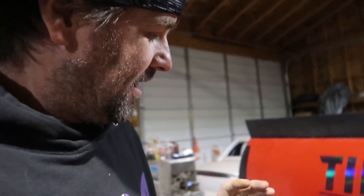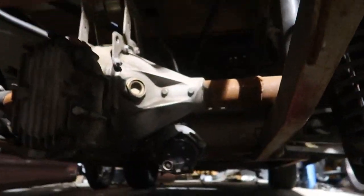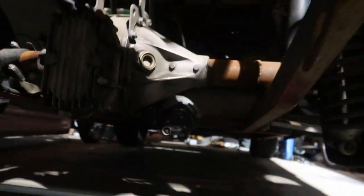We could look at changing the exhaust. We could look at driving the alternator differently, from the camshaft, whether it be where the distributor used to be, or on the front of the cam where the cam gears are, where some guys drive a fuel pump. But as of now, we've elected to try to do the same thing we did on the coal truck. I'm gonna bump some parts from my little hot rod truck. Right now, what I need to do is steal that alternator off there so we could drive it off of Goofy Built's rear drive shaft.